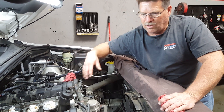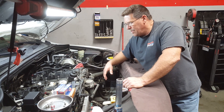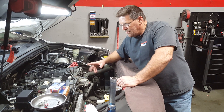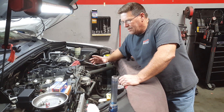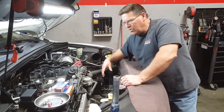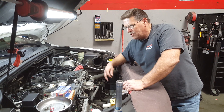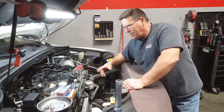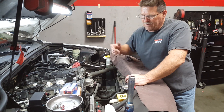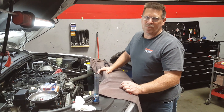So if you have a really bad coolant leak on one of these 3.6s in your Dodge and you can't find it — it's coming off the back of the bell housing — this engine oil cooler is more than likely the culprit. This job pays 2.7 hours on the Mitchell book; All Data calls for 2.5. I'm about three hours in right now doing diagnostics, but the first hour and a half was spent trying to use a camera or mirror to get underneath the back of the manifold and find the leak. If you have any questions, give me a call. This is Ron with Mobile Fix Automotive.